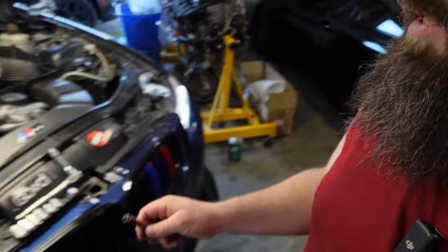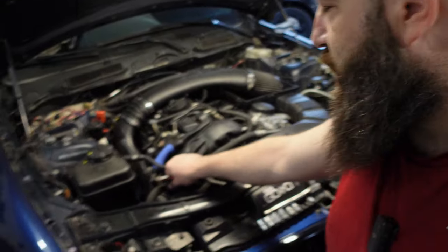Now, plan of attack: of course, we filled fluids. It does have all the coolant in it. It has power steering, it has engine oil. We didn't touch anything with the brakes. What we're going to do is crank it with the injectors unplugged. BMW says 3 sets of 10 seconds each, with 30 seconds to let the starter cool down. BMW says 3, I'll say 4, 5. We're going to wait until the motor has oil pressure, and generally, you'll see with these cooler lines, they'll start to expand when it has enough pressure.